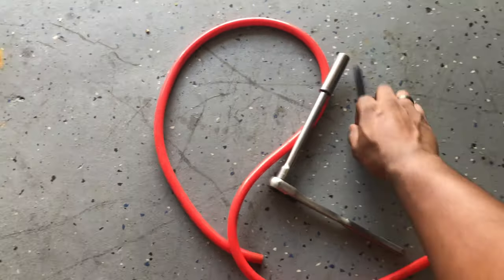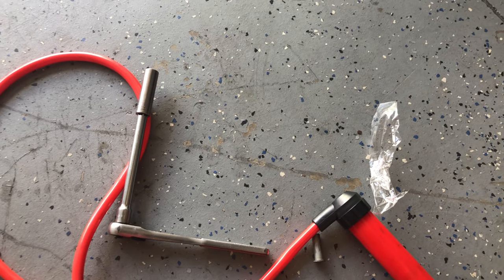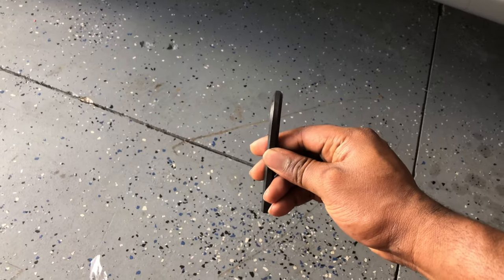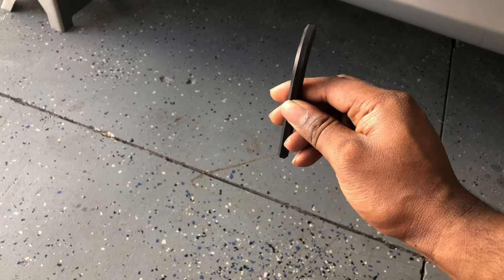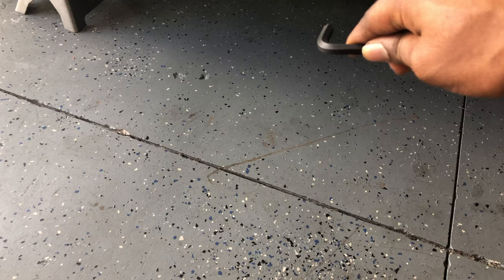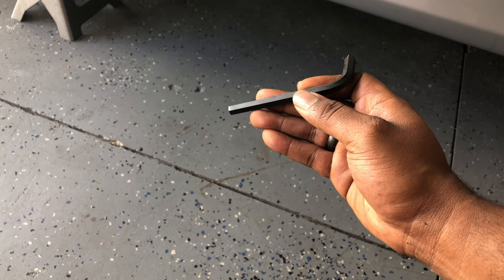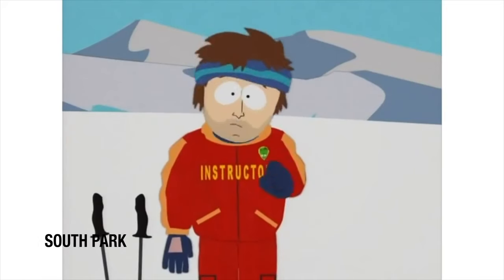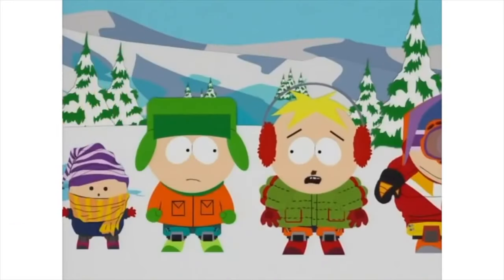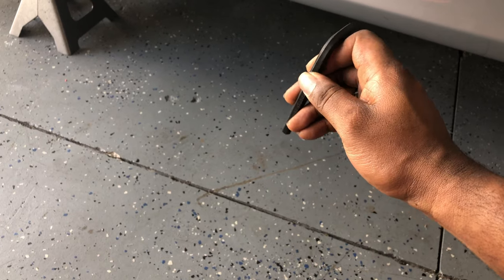I have a hand pump and an 8-millimeter, and that's pretty much all I need. To remove the fill plug on the car, you have to use one of these — a socket won't fit. Stick it in there and turn it toward the back of the car. If you go the other way, you'll be tightening it and you'll strip that bolt, and if you strip that bolt you're going to have a bad time. So go ahead and stick it in, make sure it's flush and snug, then turn it this way.